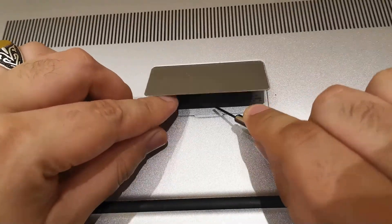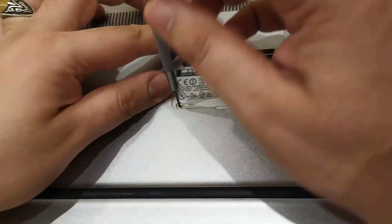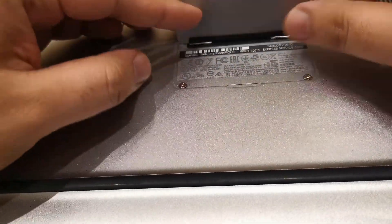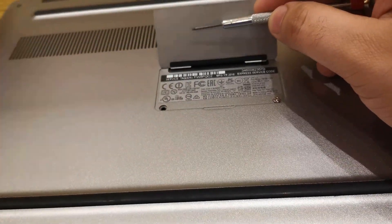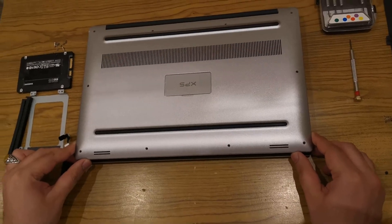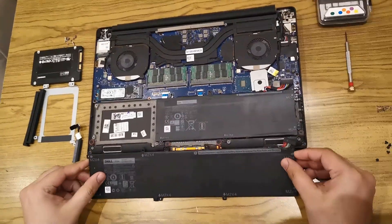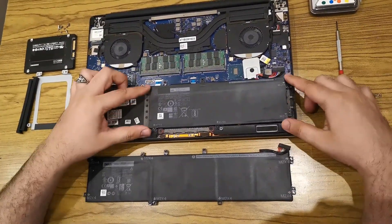Now open up the information panel flap on the middle of the back side. While holding the door open, use a star screwdriver to remove the two 10 mm long screws. Carefully lift the two corners of the back panel to release the whole panel. Do not force the panel off — if it does not come off easily, try using a plastic card where it is stuck.